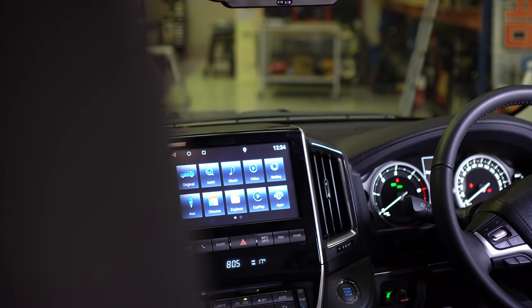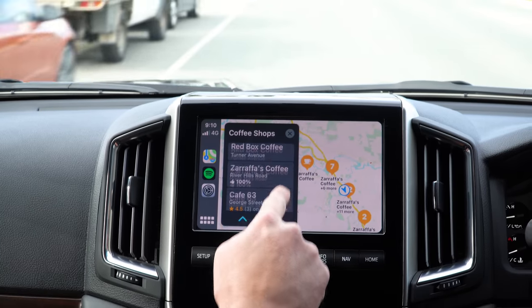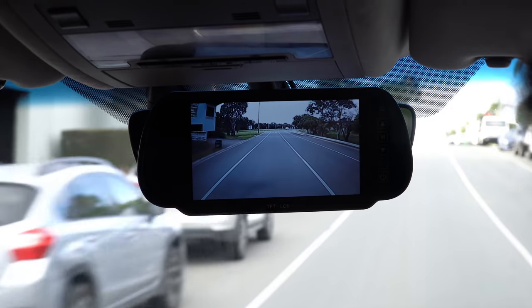Inside the cabin, we've made it really simple to use everything from the driver's seat. You've got your UHF pass-through, compressor button, airbag toggles up and down, front and rear diff locks all from the seating position, along with all your light bar switching, work lights, and rear work lights. We've used our EC Off-Road interface module which has the second camera input for his caravan, plus the other two caravan cameras through the Safety Dave on the top mirror. The interface module is also great for plugging your phone in and using Google Maps, Waze — everything that should be on these cruisers from factory. We've also got the stock lock trans lock-up kit installed, which is great when towing heavy caravans on the highway — you won't jump around looking for gears in 5th or 6th. We've also got the ultra gauge installed, which gives a good overview of temperatures of different components including your transmission — probably the number one factor while towing heavy loads.